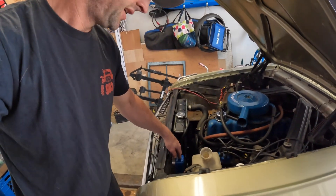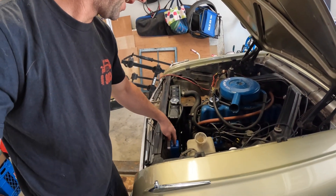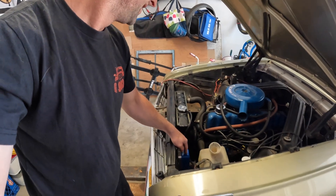I bought this 1963 Ford Falcon for my wife two years ago for her birthday, just finally got it kind of roadworthy. She'd been driving it a lot, and lo and behold, the generator gave up. I think something in the regulator malfunctioned — instead of cutting out, it stayed engaged, and we came out to the garage a couple hours later to the generator filling the whole garage with smoke.